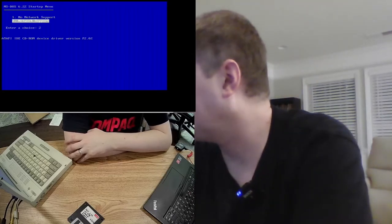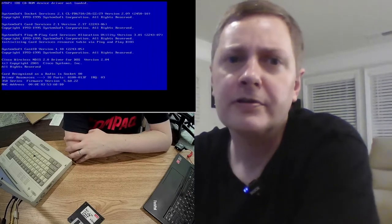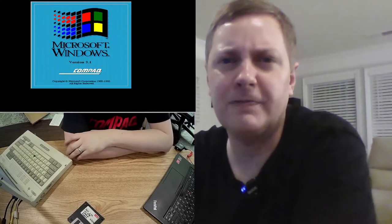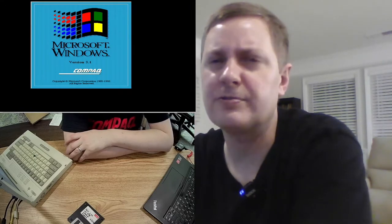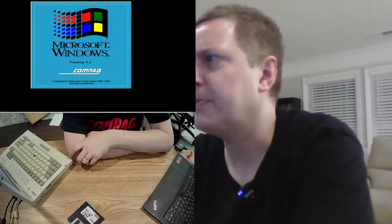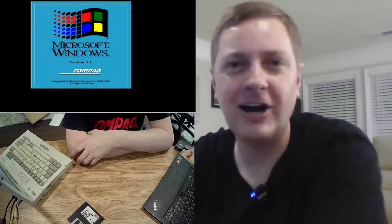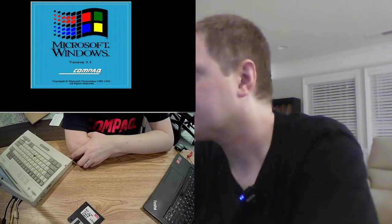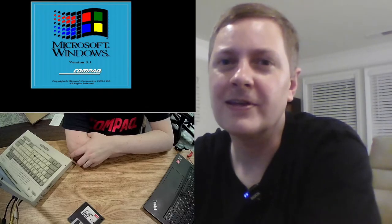Cool, so this is booting up into 3.1. I'm going to copy the 95 stuff over, and then I'll start a 95 install and let it run. Let's go to 3.1. See if we get our conflicts again. That was weird. Maybe the router at this point has dropped that metadata or those records. So we'll see what ends up happening there. Hopefully. If not, I'll just go grab another one of my 10Base cards that hasn't been powered on in a while, and we should be good there for sure. Yeah. Very interesting. So, yeah. Very good.